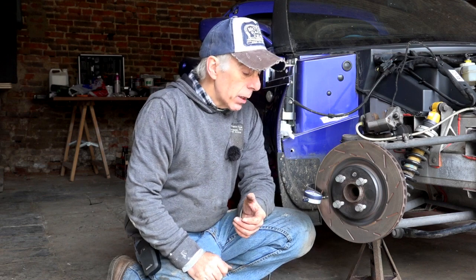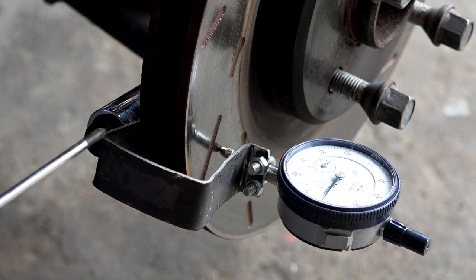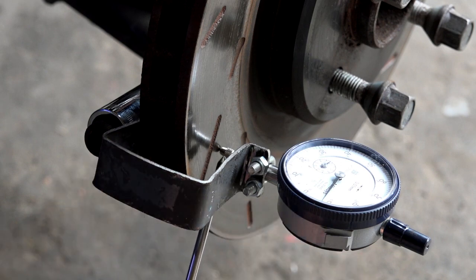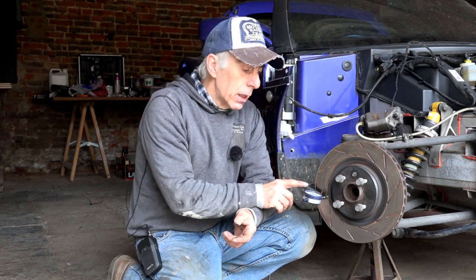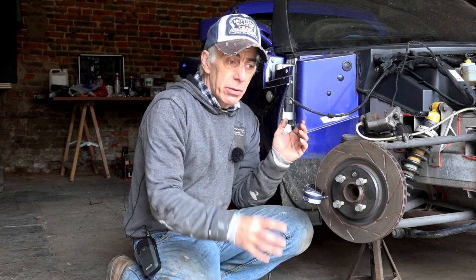You may have to build your own little bracket. I've mounted the dial on a bracket and bolted it to the lower part where the caliper normally bolts on, with a socket in between to create an offset since the bolt isn't threaded all the way. You can also buy magnetic systems, but I just built my own. Make sure the pin of the dial is touching the disc surface and is sufficiently depressed. These dials run about 30 euros. Importantly, always fix the dial on the same piece of metal the disc is mounted on — don't put it on a floor stand, as that will introduce variations.